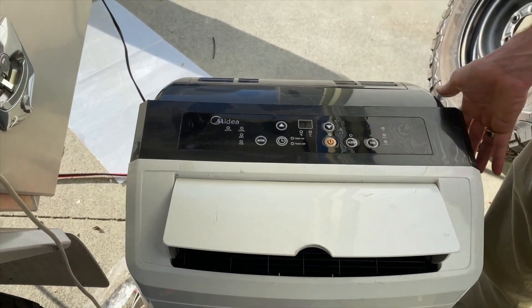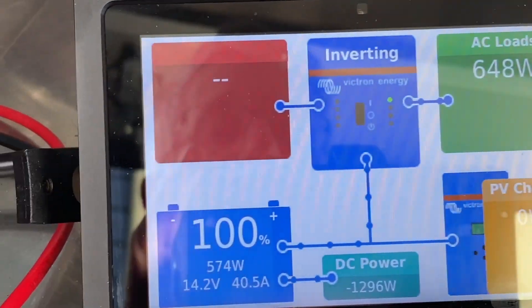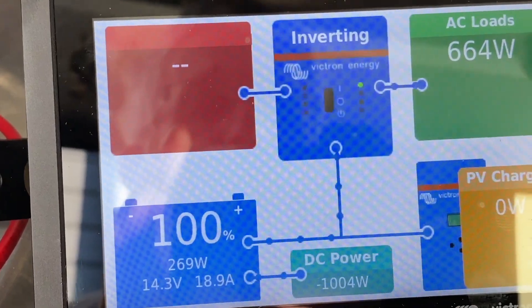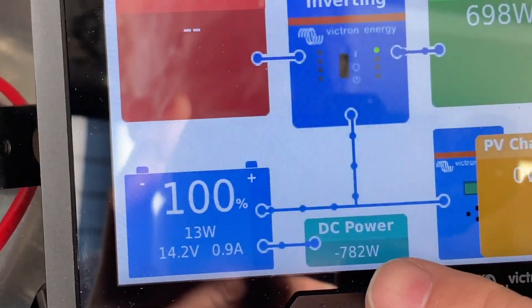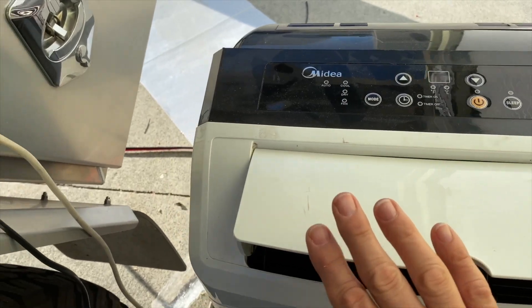Put it on Christian. The air conditioner has cut in — it's doing 648 watts. When it started up it did three times that, and now the alternator is putting in 830 watts. You would have seen it was a bit higher. The alternator is putting in enough power to match the aircon. You can't feel it out here but it's chilly in there.